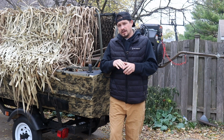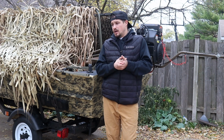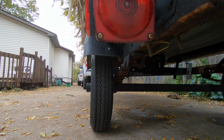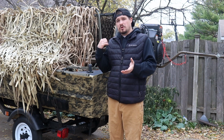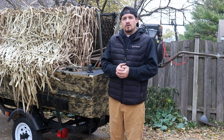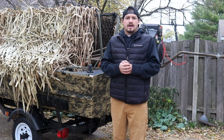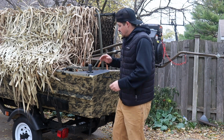So one thing I do want to touch on quick as well is one of the main reasons why I really like to do this is if I'm going on a big trip or something like that. I don't have LEDs on for my trailer lights. I only have the bulbs, and over time these bulbs, especially on long trips, like to heat up, right? Problem with this is when you go back into launch, those bulbs cool off at a very rapid rate and can explode. So make sure you have extra bulbs in there as well. Change them out if need be, and just go through, like I said, make sure that all those lights work, and if you're driving back late at night, you might save a life as well. So make sure you have those on.